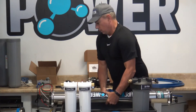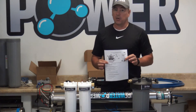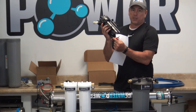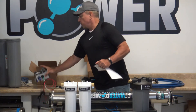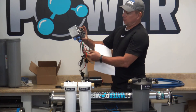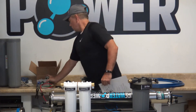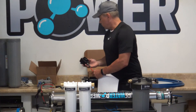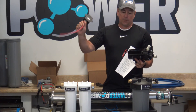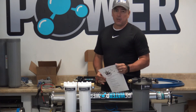Also with this kit you will get instructions for the wiring. This is a do-it-yourself kit. You have wiring that comes off the pump with a black and red positive and negative lead. On your control box you have your connections to your battery, and then from the control box to the pump you have your positive and negative leads that connect to the pump. The switch is a little bit easier to install — you're just inlining the switch between the red positive wire, with the other end going to the battery and the negative to the battery. Either way, it's very easy to configure yourself.